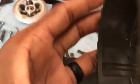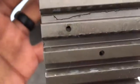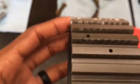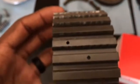What is not normal is to have wear like this, where it's really pitted into it. You can actually see divots inside the basket. So that's another sign that this crack was causing a lot of problems as the bike was in motion, which now I am sure was the cause of the fractured clutch plates.